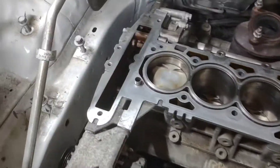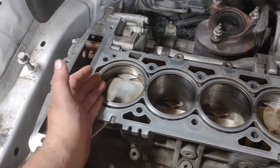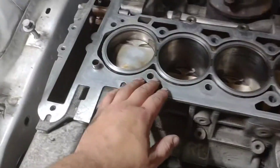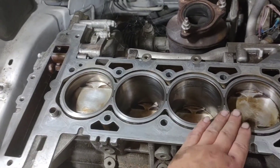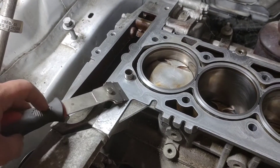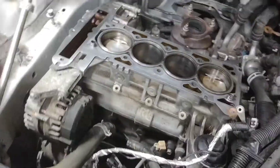What I've done so far is I have cleaned this — you want to make sure you clean this, get it nice and smooth. If it's been sitting for a while like mine has, outside like mine has, it might start accumulating rust because these are metal sleeves in an aluminum block. So I got a Scotch-Brite pad, lightly brushed everything to get all the surface rust off, cleaned the pistons up just a little bit, and used a razor blade lightly at an angle to scrape everything clean.